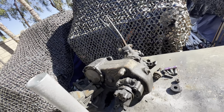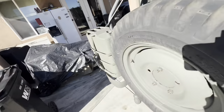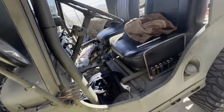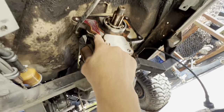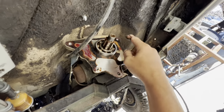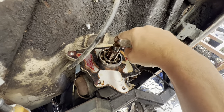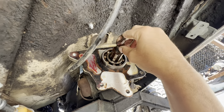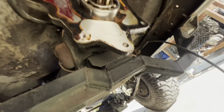I should probably go through the seals in a perfect world - we'll see how it goes. And then to put it back in, you would clean off the back of that surface, put RTV on it, clean this surface, RTV it, put your seal - you can see the little bit of the seal here. Transfer case goes back on there, mount the bolts. And then here's your shaft that you need to put that cluster gear back on there, that big bolt, the washer, and torque it down to 120 foot pounds. And then hook up the driveline and it'd be back in business.